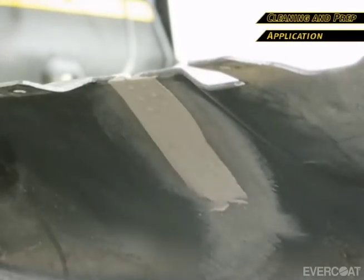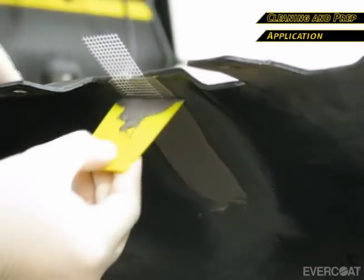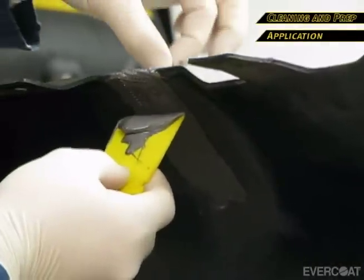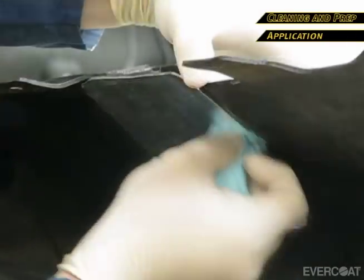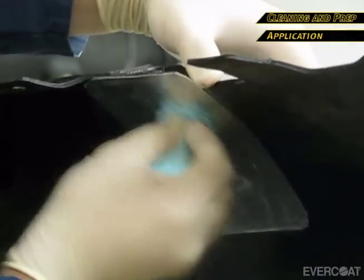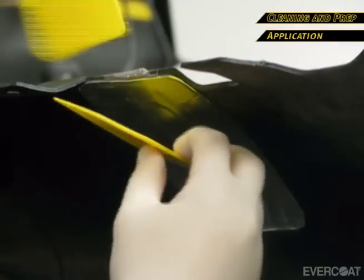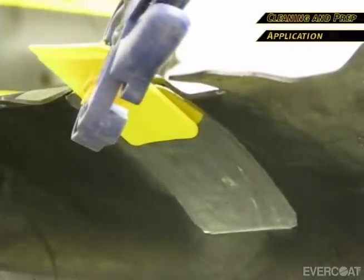Slightly build up the material and place the fiber reinforced tape on the back side edge of the bumper. Gently work the fiber reinforced tape into the material from the back side, then add more material and fold the tape over to the front side. Next, apply the pre-cut multipurpose repair panel and seal the edges to envelope the repair material. Gently work the material towards the center of the repair to work it through the holes and up through the damaged area. To help stabilize the repair, use two plastic spreaders and a clamp to hold the bumper straight while the material cures.